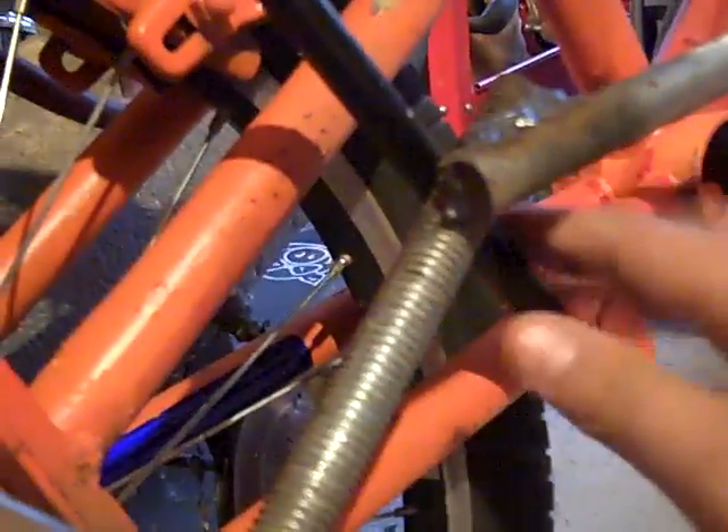From here it goes to a pivot — basically two skateboard wheels with bearings, with a bolt welded onto a piece of half-inch tubing going down. There's a little guard so it doesn't fall all the way back down. This piece keeps it in place because we made the bolt with too much play, so if it moved freely it would hit the frame.